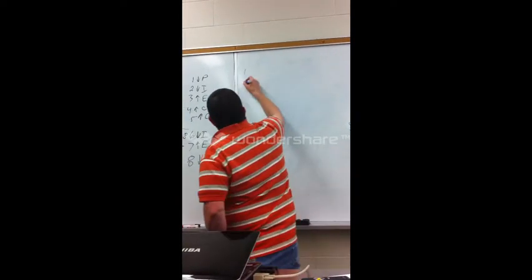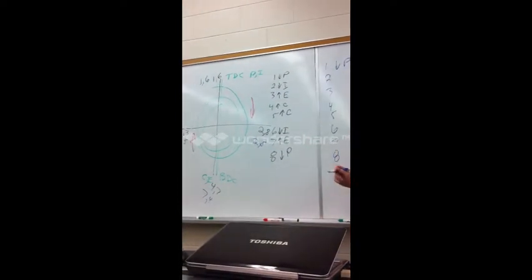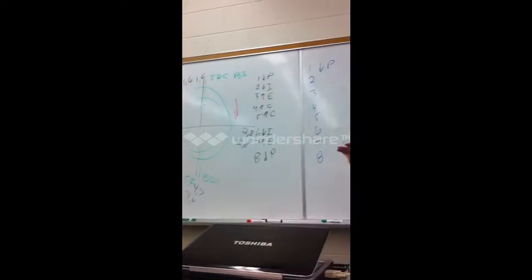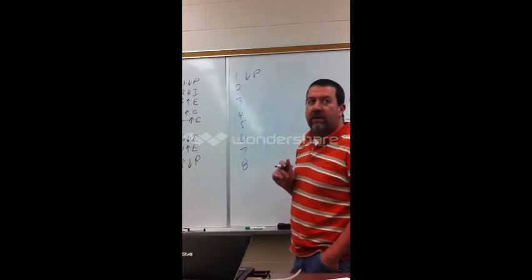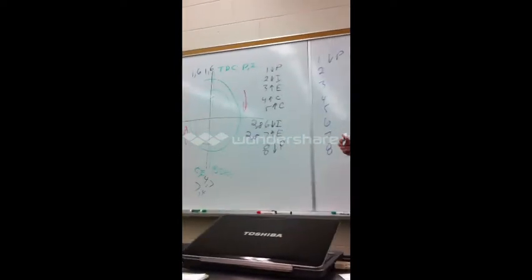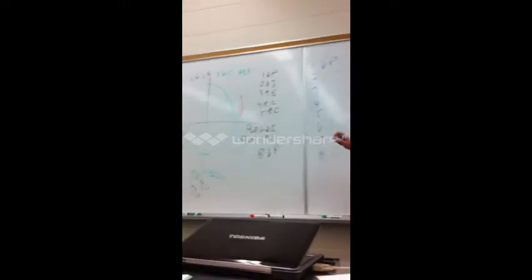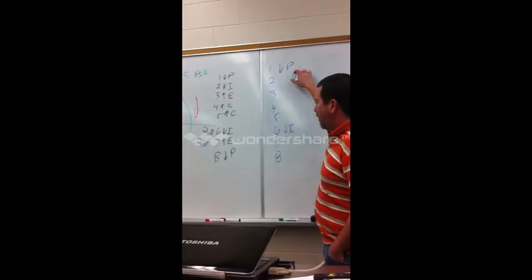Do it here. Number one is on power. How do we know that? Because I said it. I have to tell you one of them; you can't do it unless I tell you one. What's the next in the firing order? We have to do mates now. What's our mating cylinder here? Six is our mate, right? If one is on power, what's six doing? Down on intake. All right, so one's the start of the firing order.